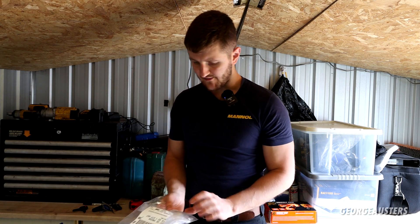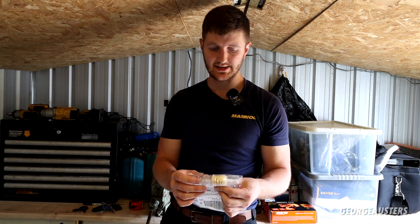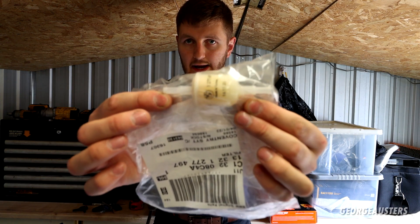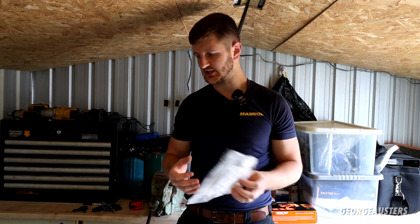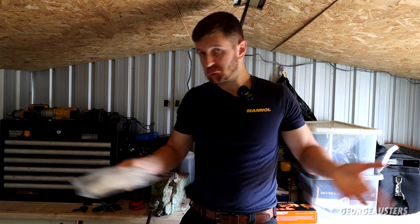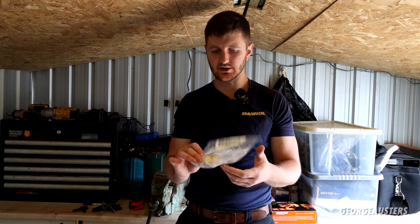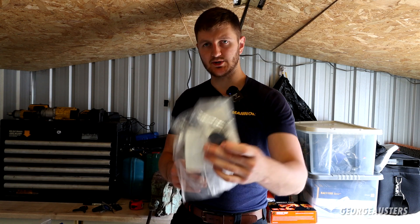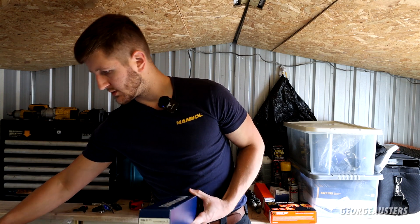We also have what's called a fuel filter — this part number is shared across so many different cars, it's just a tiny inline fuel filter — but in our case it's actually just to vent air out of the dynamic drive system. Whether we're going to notice any difference with this, nobody really ever changes these. They shouldn't really get blocked up since it's only to vent air, but we're going to be replacing it today anyway. We also have a little grommet to hold it in place.